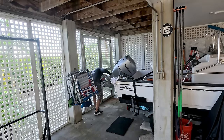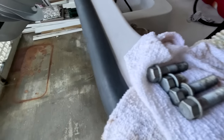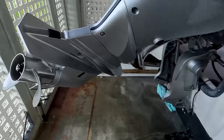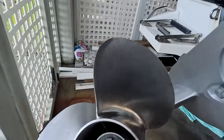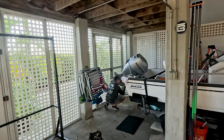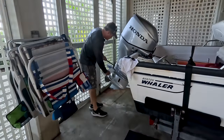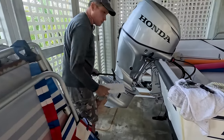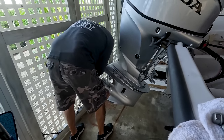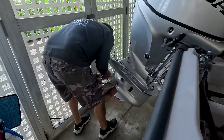Let's see what we've got going on here. We've got two sheared off bolts. One is not a big deal — it just held a cover in, so that's not the end of the world. This other one I'm going to have to see if I can get out of there; it's not going to be pretty. First let me see if I can get this lower unit off. Eric was right — this has never been serviced. I can tell because of the way the cotter pin is bent. They bent it a fancy way at the factory and it's in perfect condition.